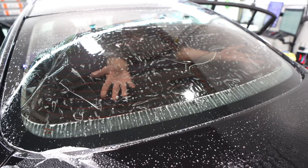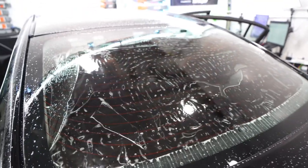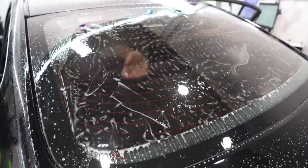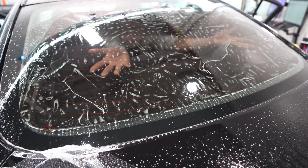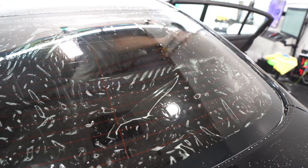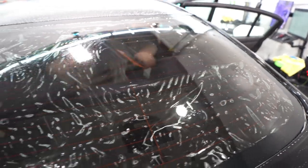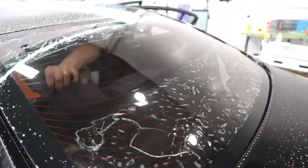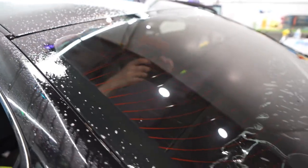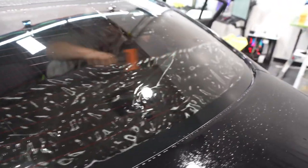When you push your film down, you can put a little bit more up on the glass, and just always avoid the headliner on the inside of the car. Push it down, push it down. I'm going to squeegee the top half of this — this is the easy part to get to. I'm using my hybrid squeegee and I just start in the middle, work my way out.